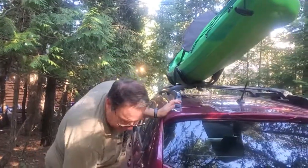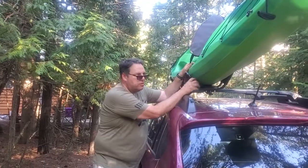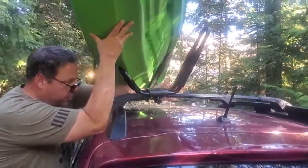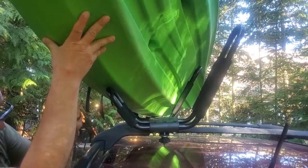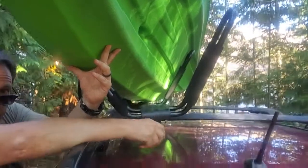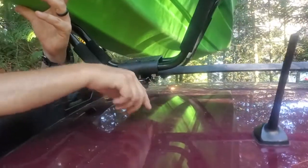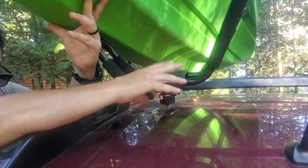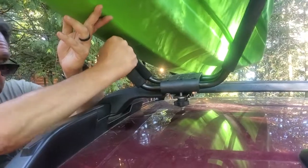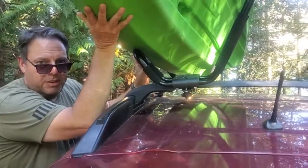In case you have a question about how to use these kayak roof racks — they're called J-racks — on your crossbars they face outside like a letter J. Remove the metal plate, remove the thumb nut, unscrew those, put the metal plate over, and tighten them as hard as you can. You want it level and tight — it should not wobble. If you pull on it, it should shake your car a little bit.